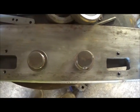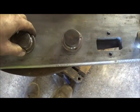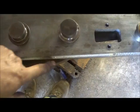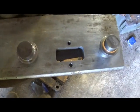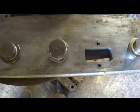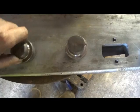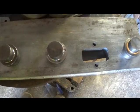We're moving on and trying to get everything ready to weld these in. Had to clean them back up because of the moisture in the shop. I went ahead and took a half-inch ball mill and ran it down through for that lip, so we shouldn't have any trouble with it hitting. Plus we're actually adjusting everything out a little bit so it's going to pull it away some. We won't have any clearance issues now. We're going to go ahead and get everything finished up on this plate. I need to drill my holes for the oil tubes — I haven't done the two tubes on this one yet. We'll go ahead and get these pins pressed in and welded in. That way we can start getting everything welded together permanently.